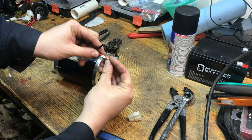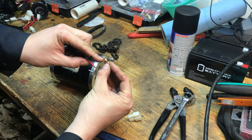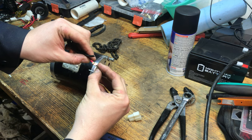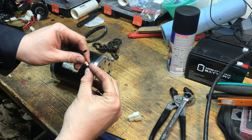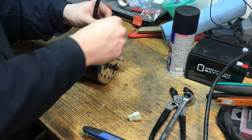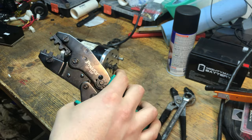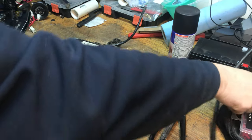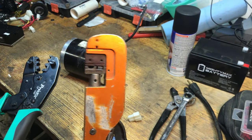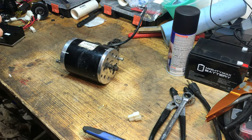And so if you can see there, those tangs will wrap around the main copper, and then this part will dig into the insulation to give it a better grip. What I'm using is a special crimper here. I think I bought these on Amazon. If I did, I'll put a link below. Absolutely love this style of crimp better than the yellow and blue and red, simple, just squeeze the hell out of it style. Let's see, 12 through 10, 14.